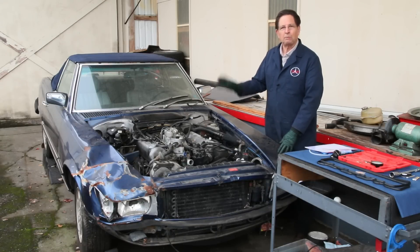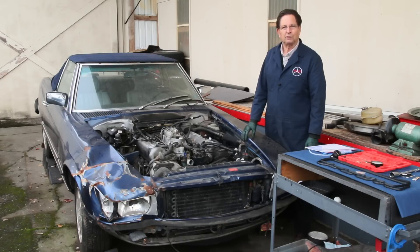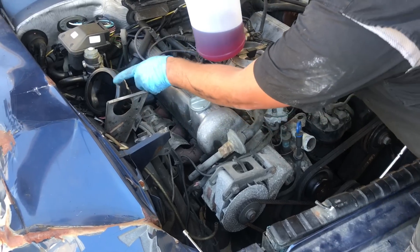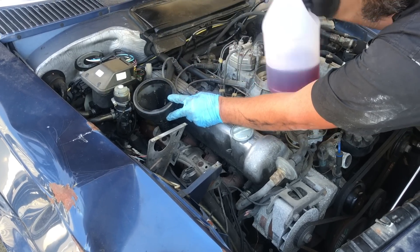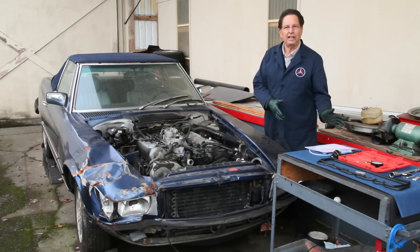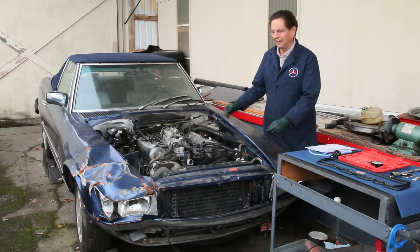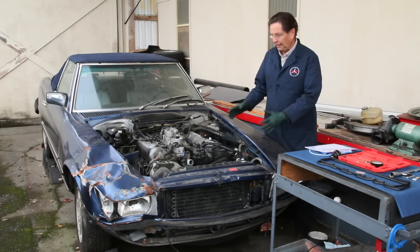Then I said okay, I'm going to do a compression test — but the engine had been sitting for five years and hadn't even turned over since 2016. Doing a compression check on a dry engine wasn't going to give me accurate results, so I went ahead and did what I call a moisturizing treatment on the old engine. I filmed the whole thing, and I'm going to include that video as part of this kit — a complete video on how I prepped this engine for a compression test, then did the compression test, then did a wet compression test on one low cylinder using the syringe to see if I could get it to change. I used everything in this kit.